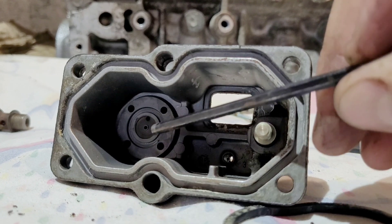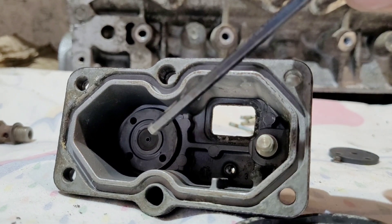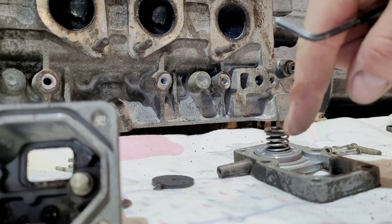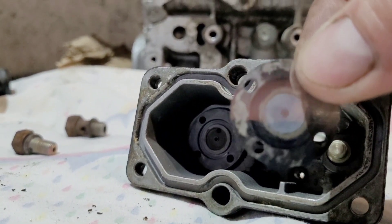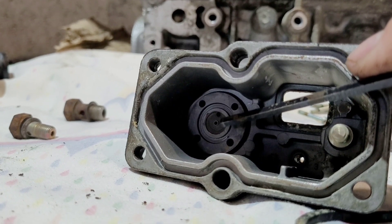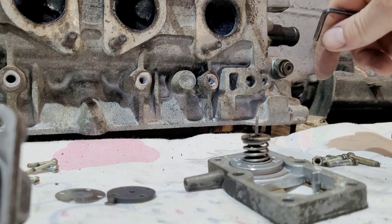The center orifice is raised — it has a raised shoulder on it which is the same height as the outer part — and the other one is not raised. Fuel comes in through the top hole, and the fuel pressure sits around that circle. If the allen key is screwed right in and the push rod is pushing fully on the metal disc, it will completely block any fuel going out that hole. With pressure in there, the fuel pressure will push the disc off slightly, which is relevant to the spring force — a factory setting allows a certain amount of fuel through.